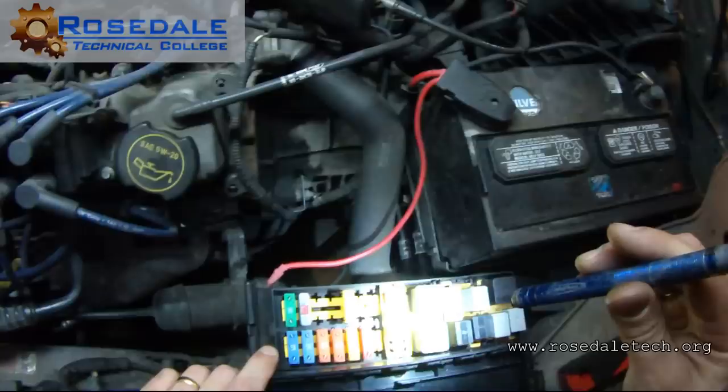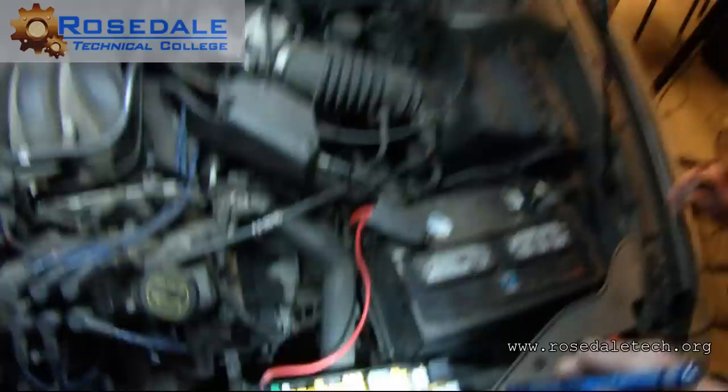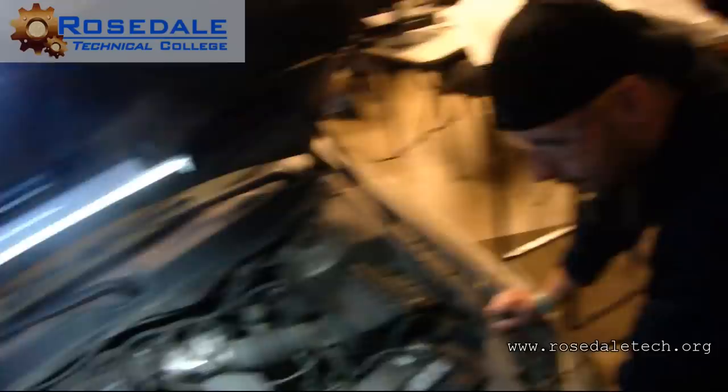And that definitely did not look like, I mean, we pulled that fuse out. If that was truly the coils and injectors, the car would immediately shut off. So that delayed shutoff is still? No, that might be the fuel pump, potentially. You saw me pull the fuse out, the car's still running. There's no way the car is running if that's the right fuse. It's the wrong fuse. We can learn that test on another car. I'm good with where we are on this right now.